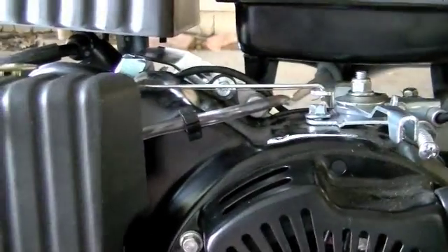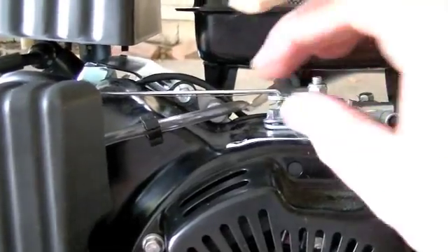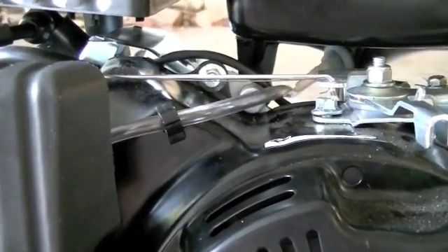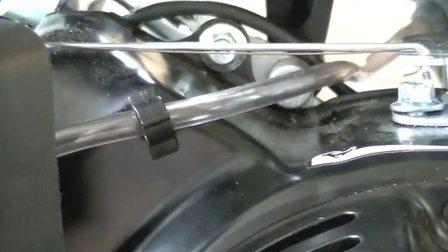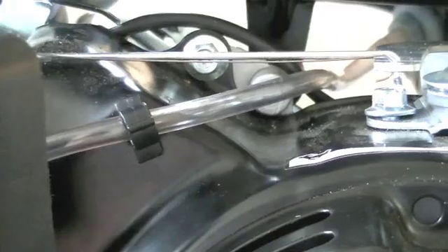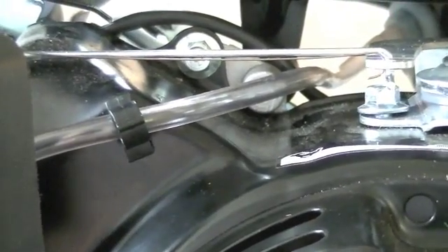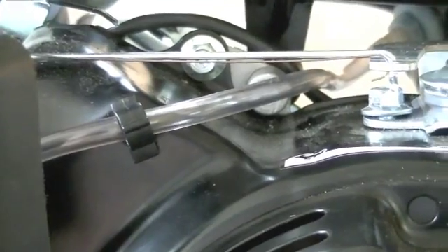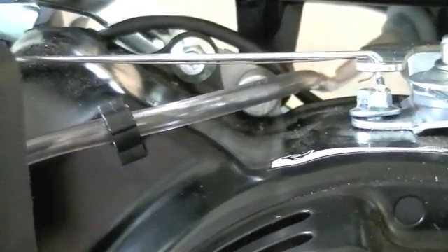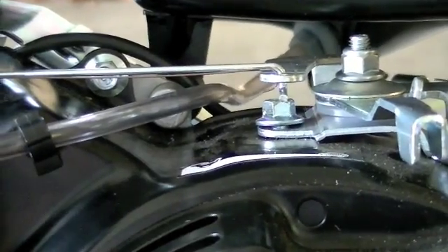I didn't end up using that fuel filter — it was just way too big to get in there. But what I was able to find was this clear plastic tubing. To tell you the truth, I'm not sure if it's fuel resistant or not. This is probably some leftover stuff. My older roommate was building a motorcycle and I do remember him using this for his fuel line, so it might be fuel resistant. I put one end of it into a can of gasoline for about 5 minutes and it came out the same as it went in, so at least for the time being this is good enough and we can test everything.